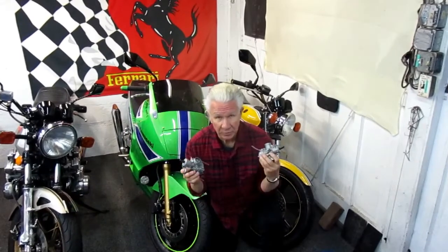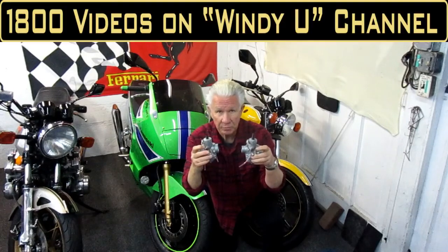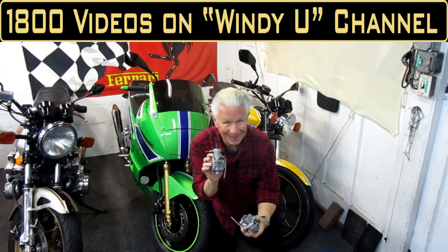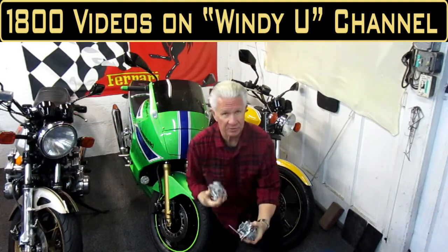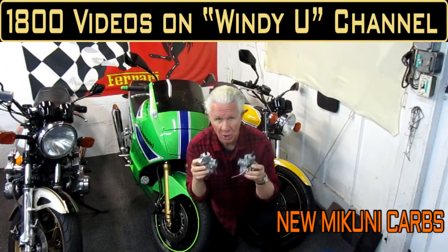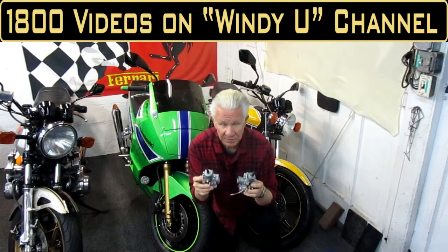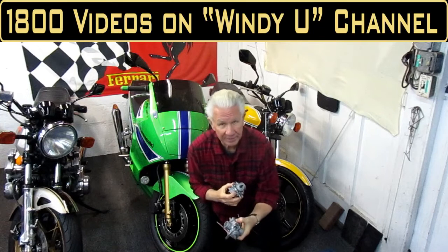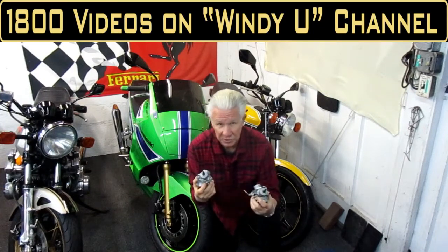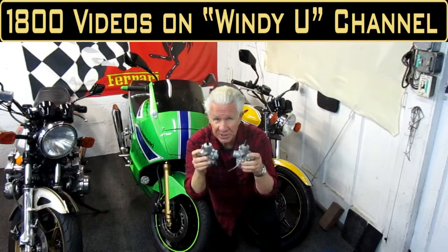Today is the day we've waited for a long time. I wanted to have a dedicated shop day to install. I have two brand new Mikuni carburetors that are replacements, but not exact replacements for the carbs that are on the bike. And if I can get these to go on as conveniently as I hope, there is some drilling to do, there is some fitting to do, and it just isn't as simple as you think it is for a lot of reasons. First off, there's two separate chokes, there's no connecting line, no balance tube, but we're going to see if we can get these to fit.